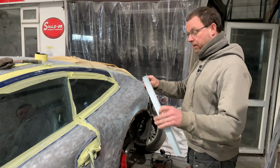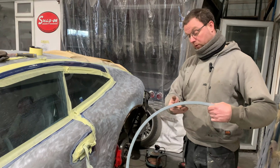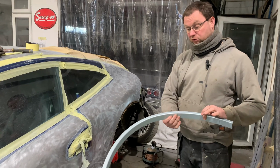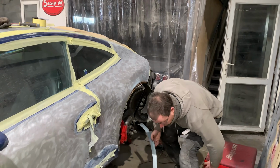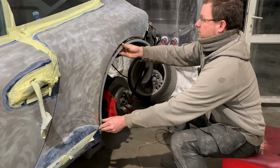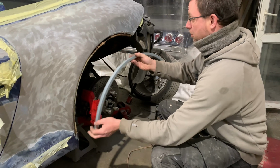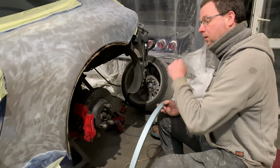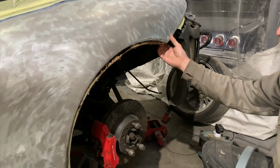Okay, so we've cracked on, and it's nice and simple with this, a decent shape, nice and straightforward. On the shrinker stretcher we've made up our wheel arch lip, which you would have seen, and which goes in something like that. It does fit. The problem is, this is all pushing it down out of the way now. One of those jobs where it just keeps on growing, sadly.